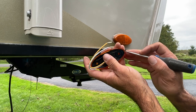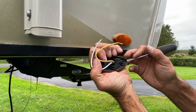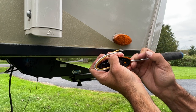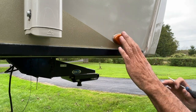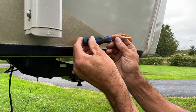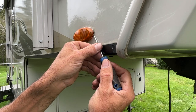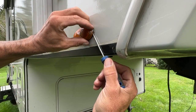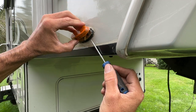You put your pry tool behind here, then press the lens off the top — it clicks right off. This one comes apart, but the notch on this side is over here, so it doesn't work from this angle. You need to go in on an angle, get your fingers in back there, and pry the lens off. There we go.